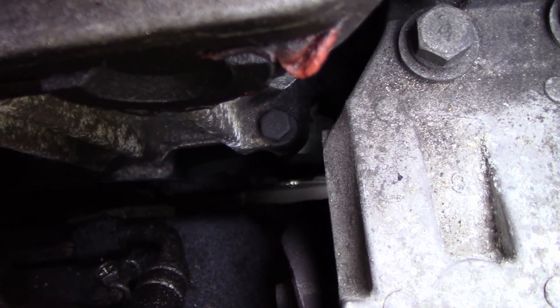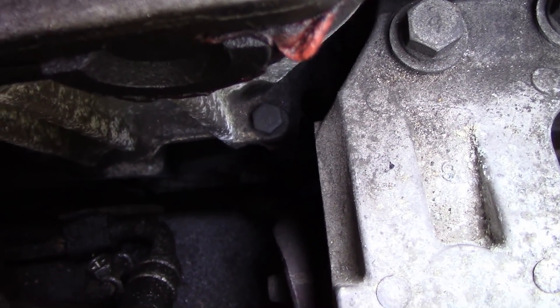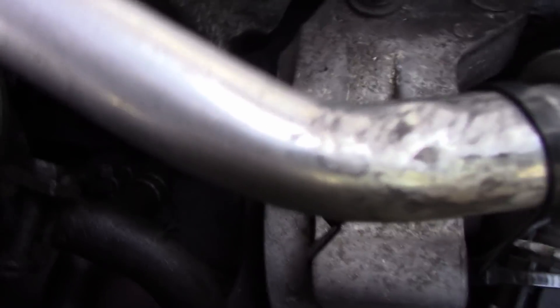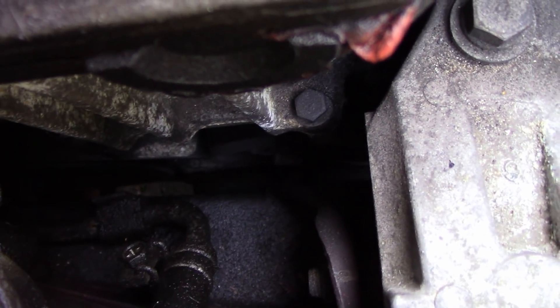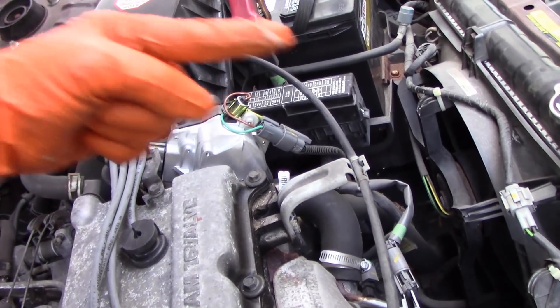You can see the little white mark — it's above that little tip that I need it to be at. So I'm going to go ahead and clock this, move the distributor a little bit, and see if we can get that mark to move back the other way. The white mark has to go back to the little nipple a little bit further back — just a smidge. The timing point is just to the right of that white mark, so I'm going to clock it just a bit more. We're going to turn the distributor that way.